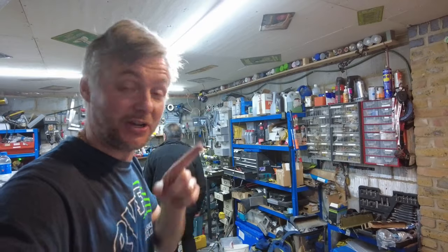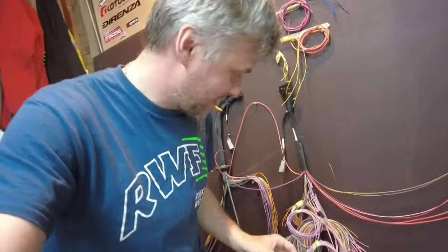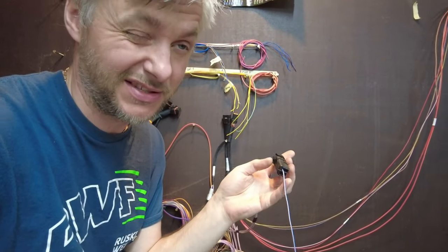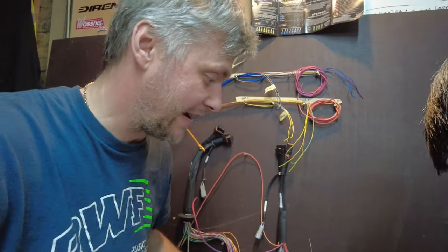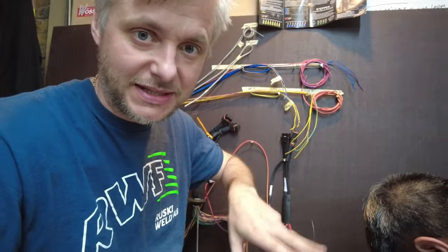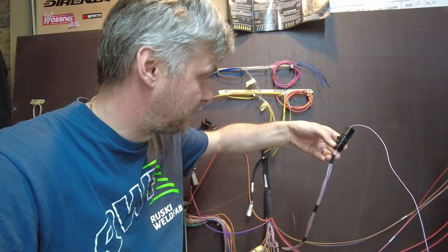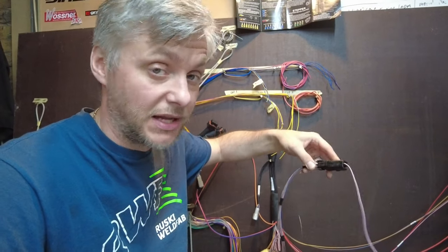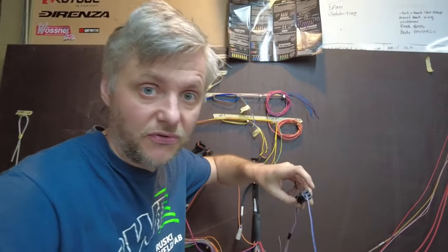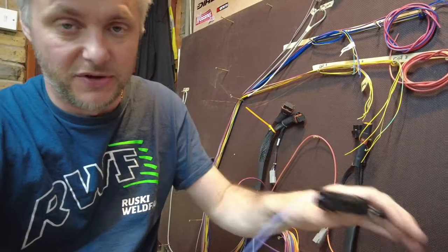That's how you make a loom. The first one is kind of done — laborious process of categorizing and going through everything. We've put on the first connector. Some may say it's a little too soon, and I agree, because plugs are usually the last thing you do. But this is an intermediate plug — this is your PDM side connecting to your front loom, and the back loom will be separate. We'll have two or three of those plugs: one for lights, indicators and brake lights, another for the fuel pump. You can literally unplug those two and your rear loom is completely detachable.